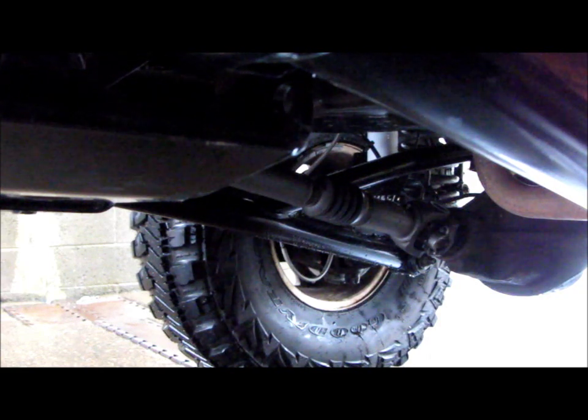For my setup, the instructions said somewhere around 3.5. With the alignment all set, I'm now right around 4.0, maybe 4.2. When I was at 2.5, that's when things were a little sketchy. So it's handling a lot better now. Again, it's a trade-off: driveline vibration versus steering comfort.